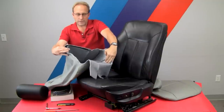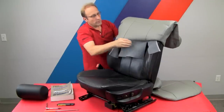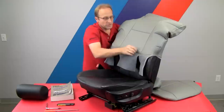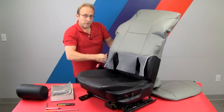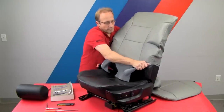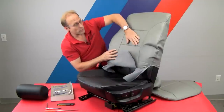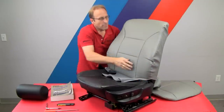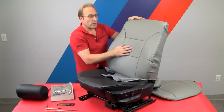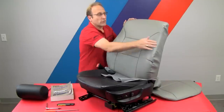The upper section is just one complete unit, like a sock, so we'll slide it over the top. You do need to be careful in pulling it down — these fit so well that they're going to be fairly tight. Don't just yank it down; work it slowly and push the bolster in to make room to slide the cover on if need be. Pay attention: this is a four-door car so there's no levers or handles. If this were a two-door car, we would typically have a handle to flip the backrest forward, so make sure you get the proper cover piece with the proper cutouts.